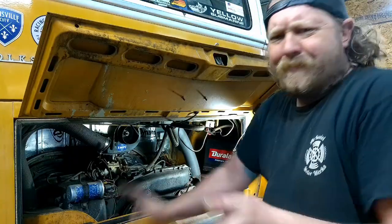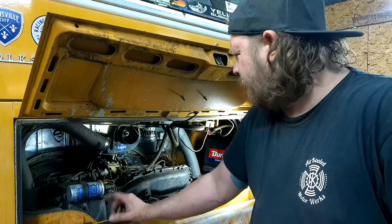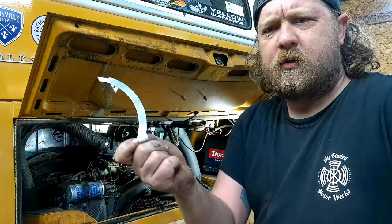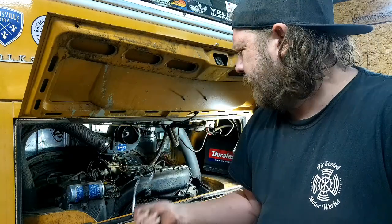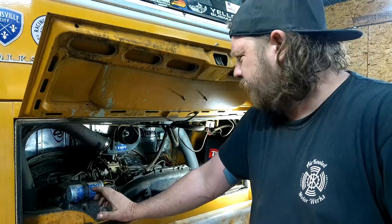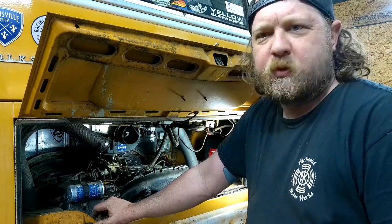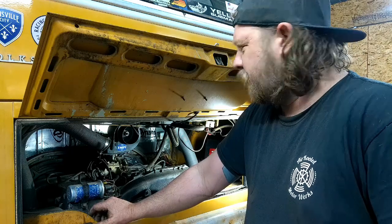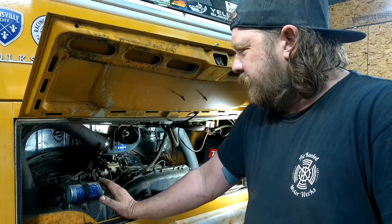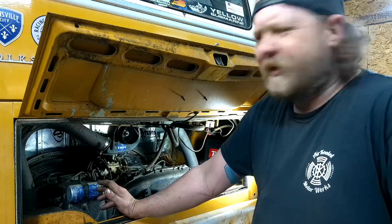All right, it's elevated a little bit because I'm standing and it's in my face. But the other thing I'm going to throw in is the timing mark bar. This one doesn't have it, and if you know anything about these pancake engines, you kind of need it to set timing. Otherwise, you're just ear timing. Not saying that's what's going on, but it could be off. It's still running points, too. Talking to him, he doesn't know the last time they've been changed or adjusted. So that could be another reason. It sounds like it's running a timing issue.